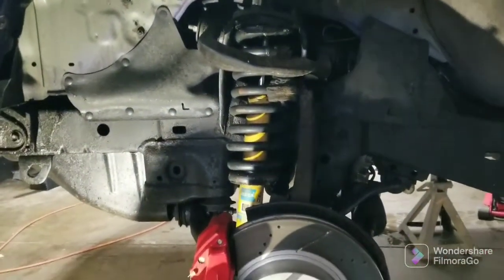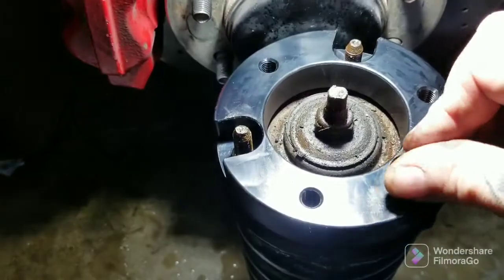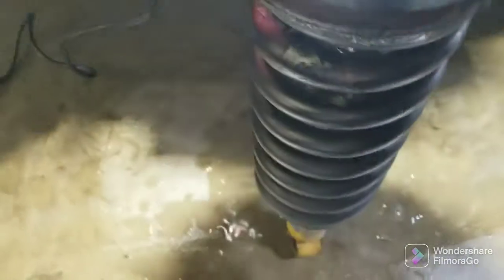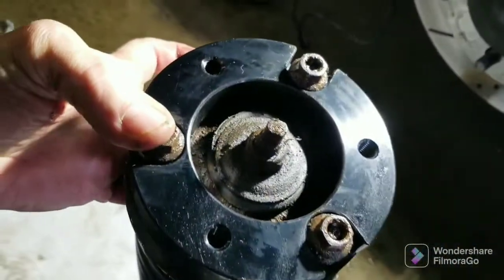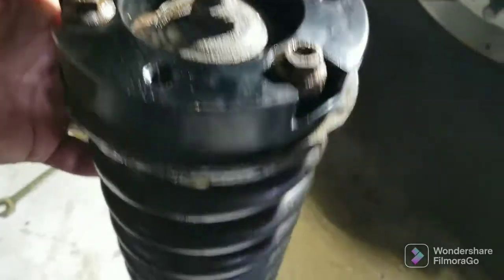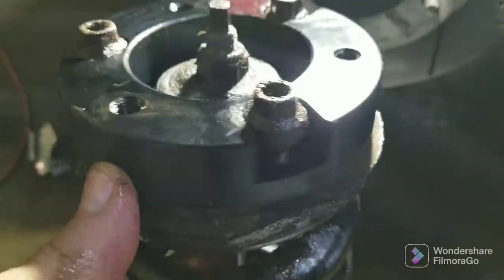I'm gonna get started on this. Right now it's just some bolts out. I'll come back and hit the high points. Now this little aluminum piece just sits right on top of your strut. Use the same three nuts you took off of your strut to put this back on. And you'll notice as it falls over, this now when you put the new piece on where your bolts, your studs, were coming through, it's going to move that. They have made this as such that you just turn the strut 180 degrees and they line up perfect.